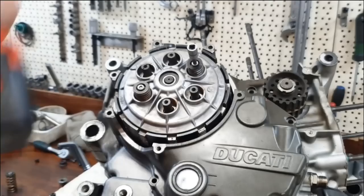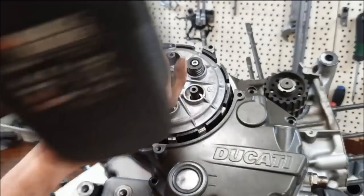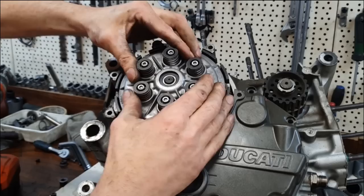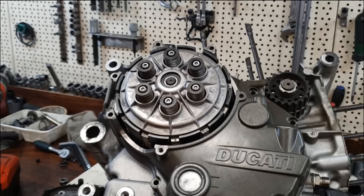And here you can see, even with the modification that we put in with completely worn out plates and all the springs back in, it hardly moves, but it's only because there's friction from the convex ring in the back. So basically when you're driving, it's either one way loaded, or if you brake on the engine, it's loaded the other side, but it cannot do this anymore in low RPM or in idle. That's basically the basics for mounting the clutch modification.